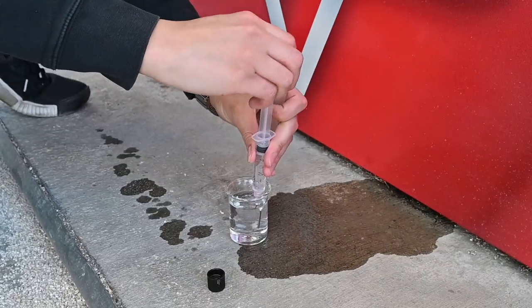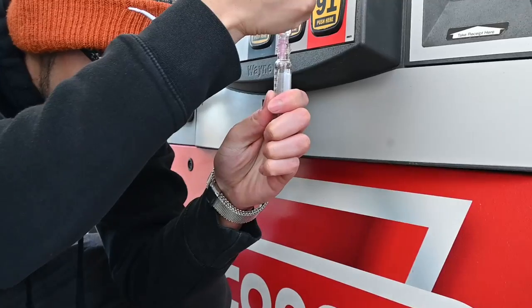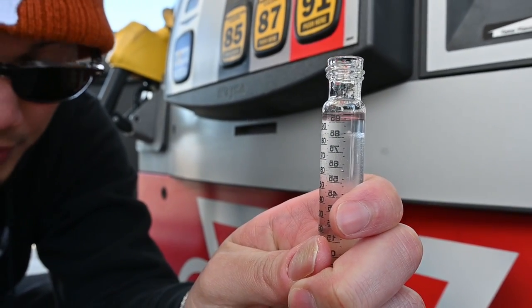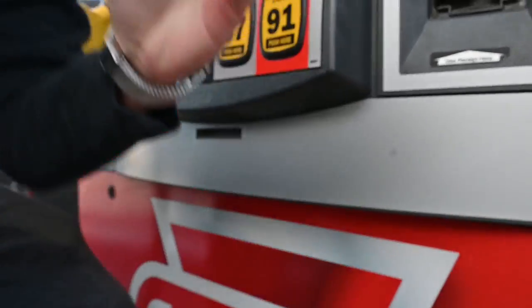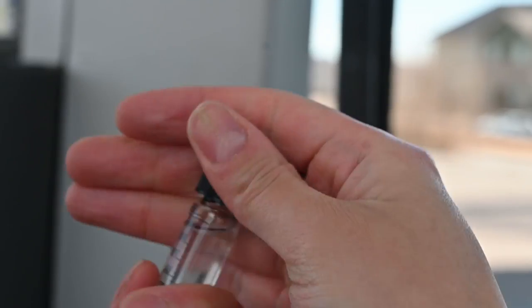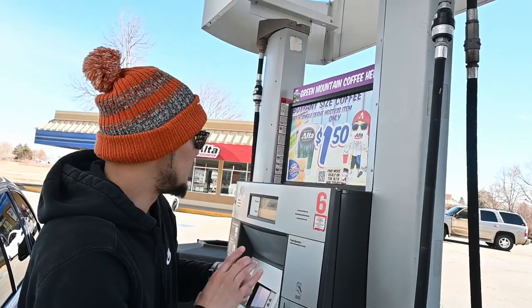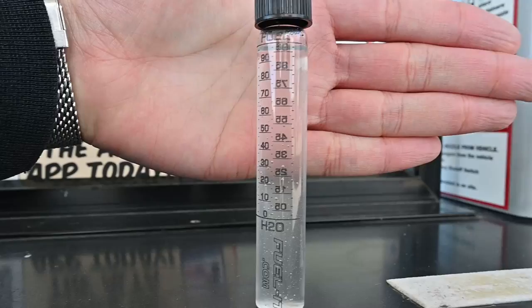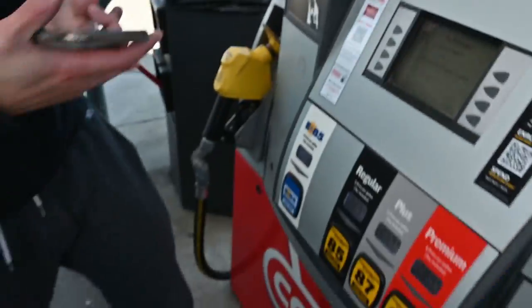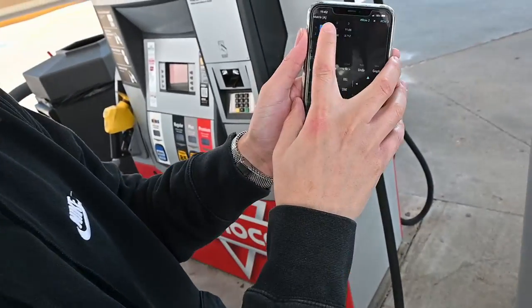We already get most of that in one go here, and this next one pretty accurate. About there — perfect. So we got the fuel line pretty close to that line. Put the cap on. So that tells you it's e85? Basically you fill the water to here and the fuel to here, close the cap, make sure there are no leaks, give it a good shake, and it takes about two to three minutes to separate. This one's reading pretty close — about 85. Yep, it usually is.